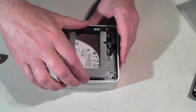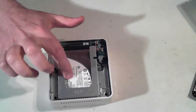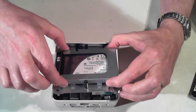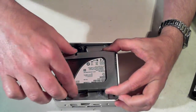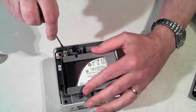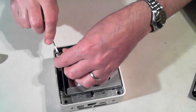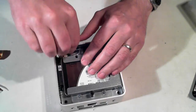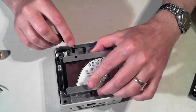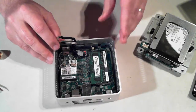There we are. Now, as you can see, on this bit there's an SSD drive — and that can take any two-and-a-half inch drive. We can actually remove this bit, but we've got some cables here we just have to be careful of, so I'd recommend you remove them first. Just get a Phillips head screwdriver under the connectors and they should just pop up. They may be held in by a little bracket, so just pull them to one side, and the hard drive, or the storage device, will come out.